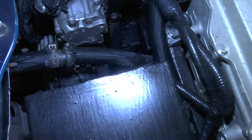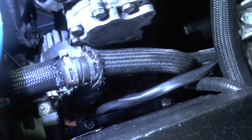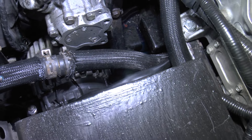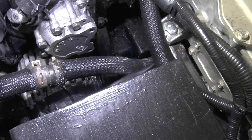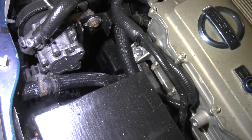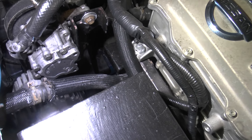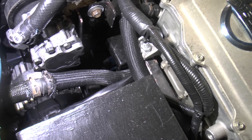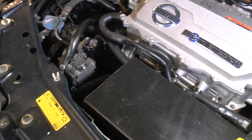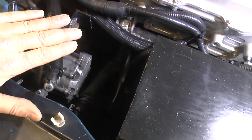Right now it's a little hard to see, but down in there is an alternator from, I think, a Volkswagen. What I did was I took all of the electronic components out of that alternator and connected a low voltage to the brushes on the rotor, which turned this alternator into a three-phase electric motor. I then drove that from an e-bike controller and used that to drive the power steering pump, which is this top part here.